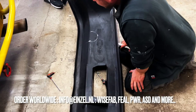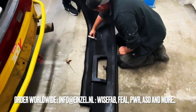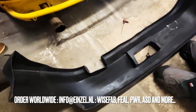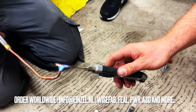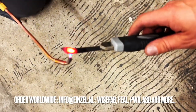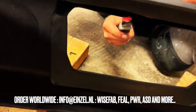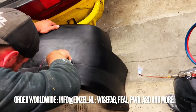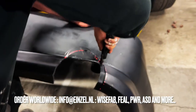After marking for the exhaust, we figured it would be a good idea to use a hot tool because this is not fiberglass — it's completely different, almost like a rubber mat, although it's a little bit lighter than fiberglass. So we heated up a box cutter and did a little test to cut off a small tab behind the license plate, and it worked really well — like a knife through butter. Then Tice continued to cut out the exhaust marking.